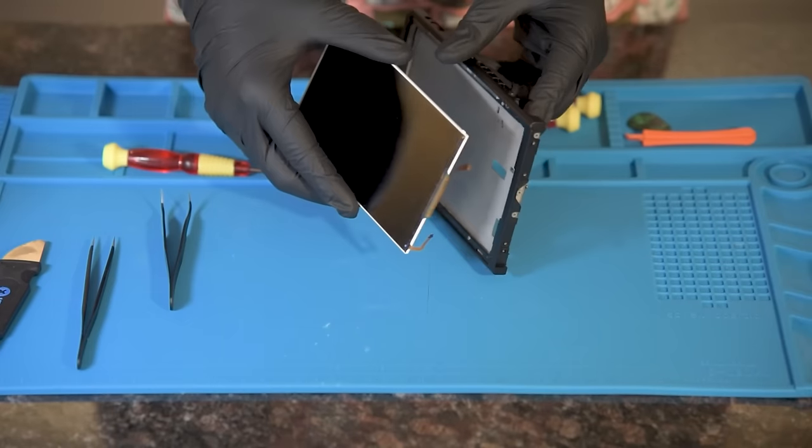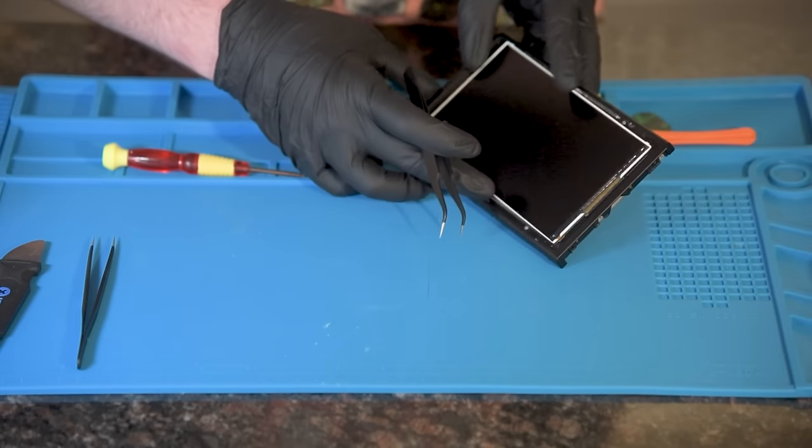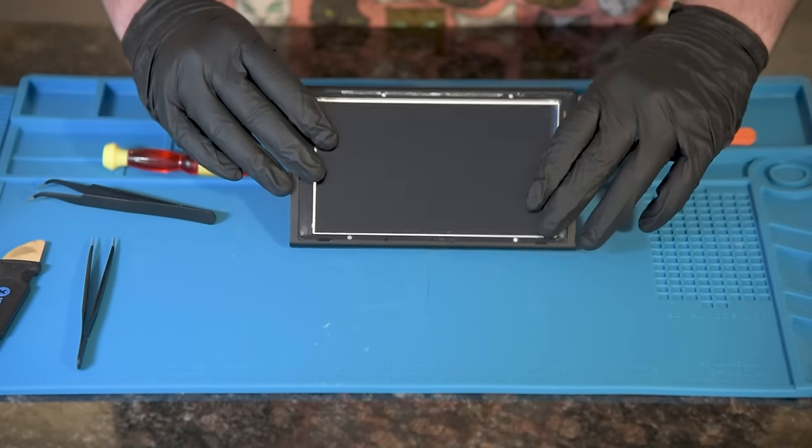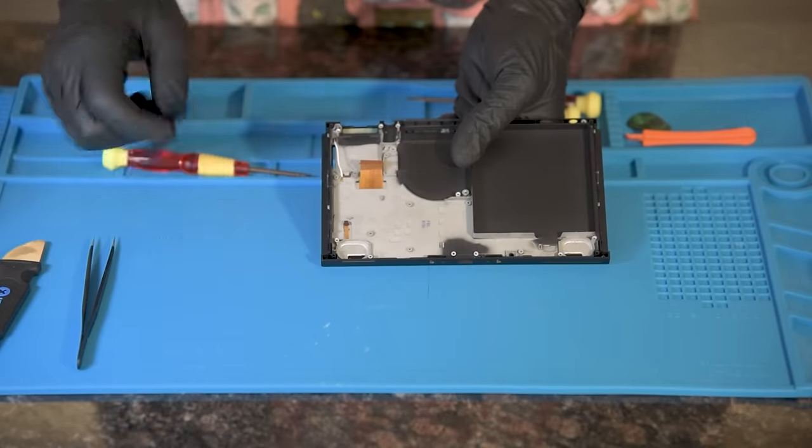It needs to have the end connector shiny side up when placing it. The small cable at the bottom needs to be shiny side down. Both should lay flat and have no sharp folds. I went through two displays because I was not nurturing enough.